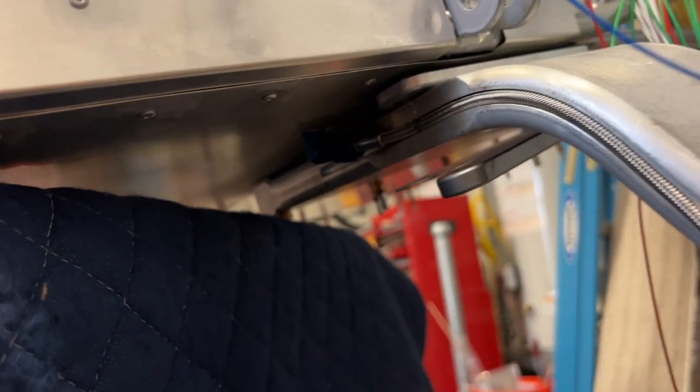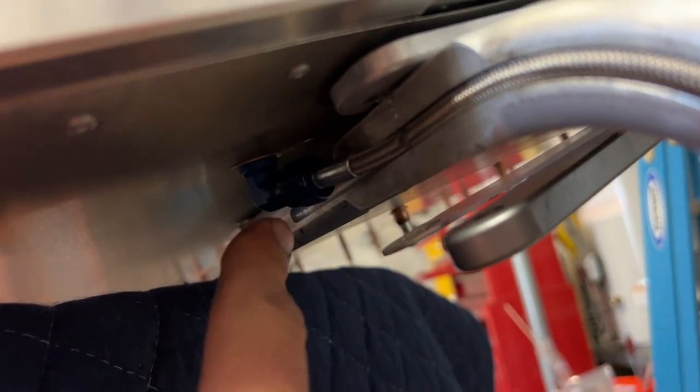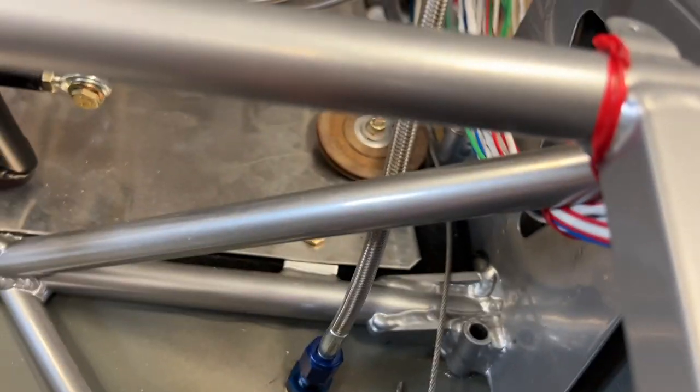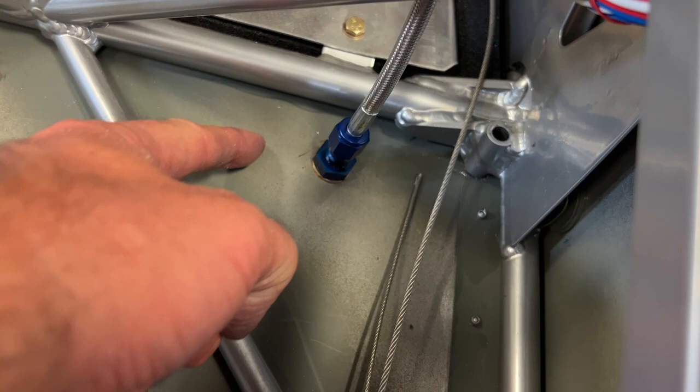This is pretty frustrating. The location of that fitting is so close to where the bolt mounts that the line is getting a little bit kinked — it's even chafing right there. That location is bad. I need to fill that hole and move this fitting over so the line can gracefully flow into the channel and be well seated by the time the bolt bypasses it. It's just too compact — not good for this line.